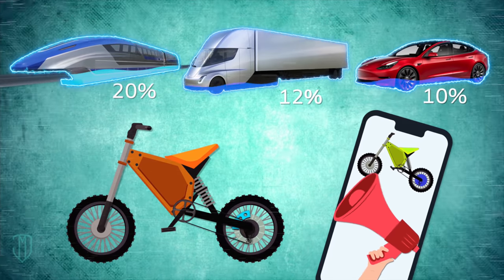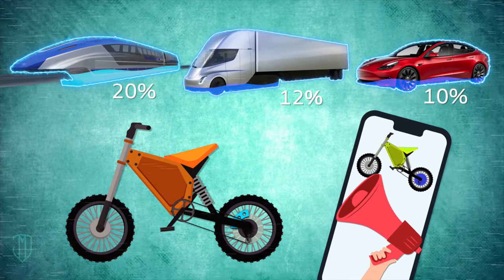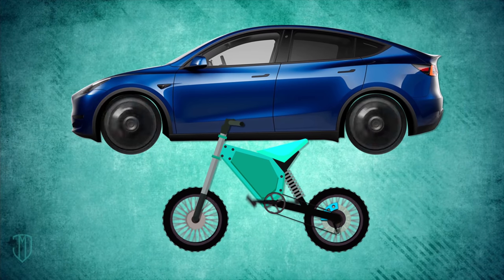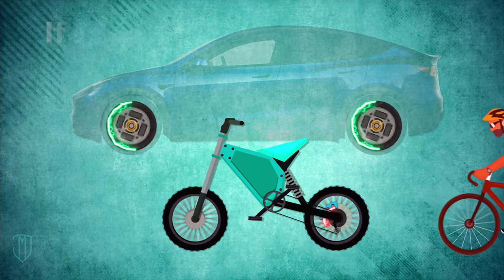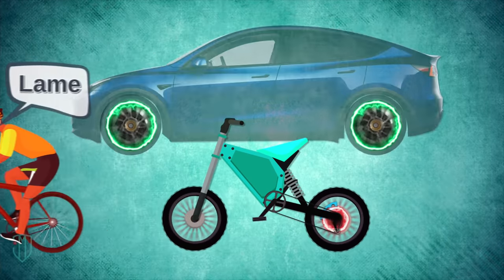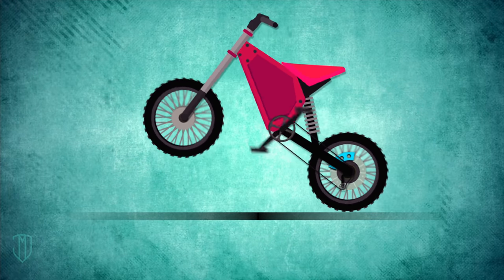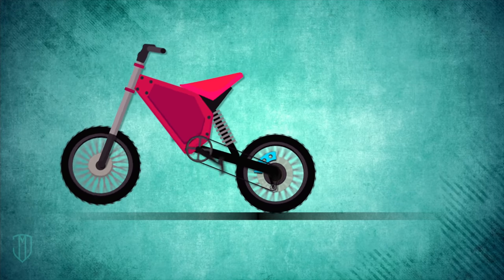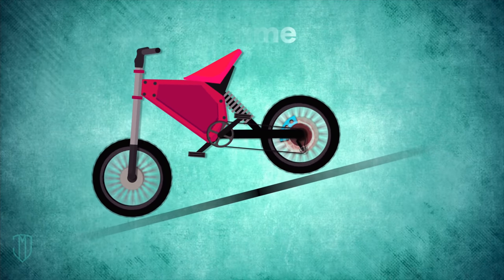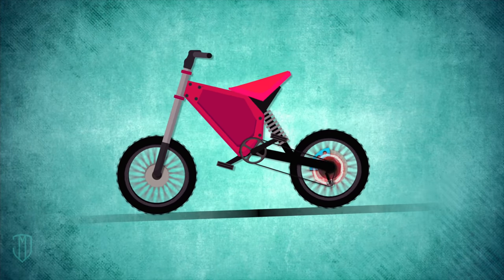In reality, you'll be paying more for brakes that'll give you very little benefit, or even work against you by consuming more energy rather than saving. That's because regenerative brakes work optimally when the electric motor is always engaged, whether as a motor or a generator. That's why it's beneficial for an EV. But people's behavior on an electric bike is different — an average cyclist engages his motor only part of the time and happily just coasts for the rest. So there's not much energy you generate and therefore not much to salvage.